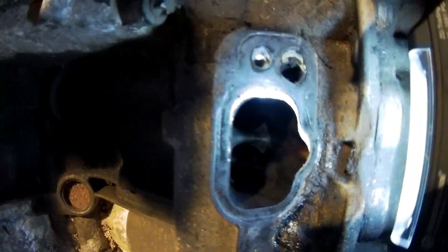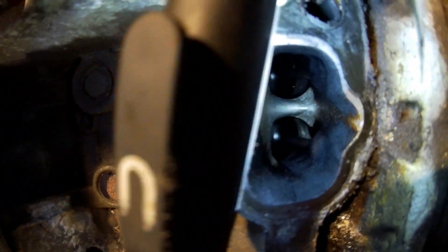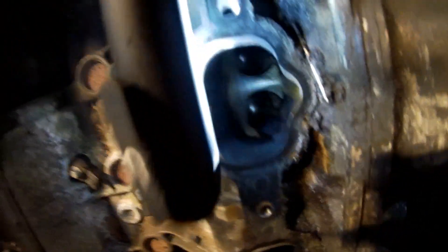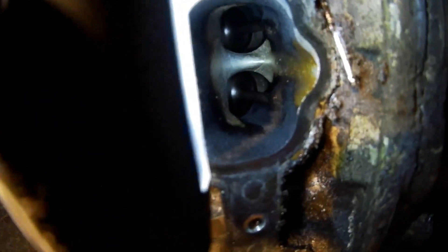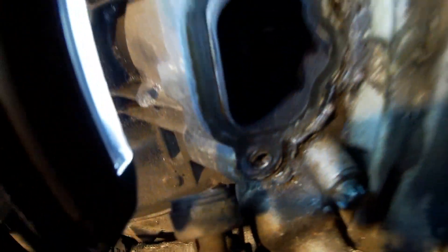As you can see, what I'm very surprised about is that the runners are very clean. Only the first part of the intake runner is a little bit oily, but that's pretty common. There is an EGR system in it. If you look at the valves, they are very clean. I'm pretty surprised — there's not really any carbon buildup on them, which is very good because they do get heavier over time. You can also see that there is no real oil burn, so the intake runners are clean — no leaking valve stem gasket.